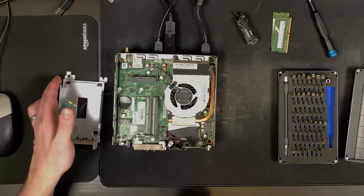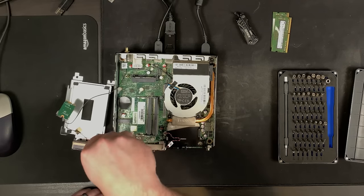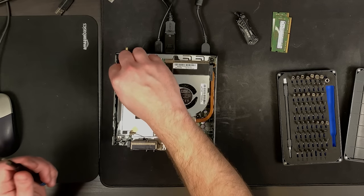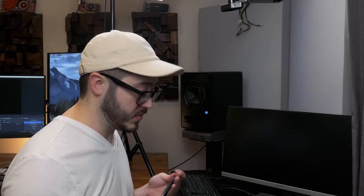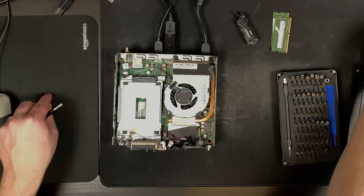Because if all I have to do is buy a couple of DIMMs to get two of these up and running, I'd say that is a big win overall. These have been really easy to work on though - I will give Lenovo that. It's one screw to open up the case, one screw to take off the hard drive caddy to change RAM - two screws total. That is not bad at all. Good job, Lenovo - occasionally you do things well.